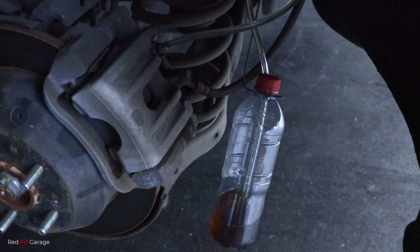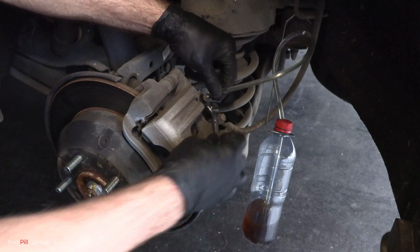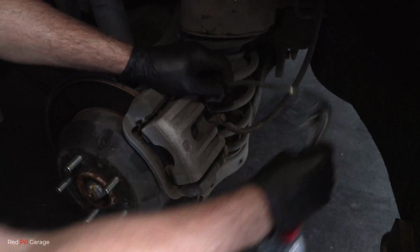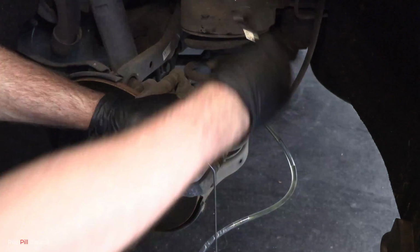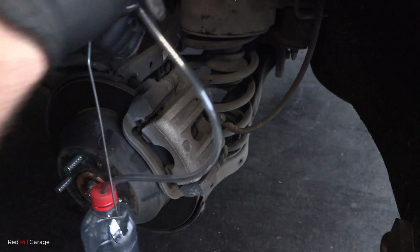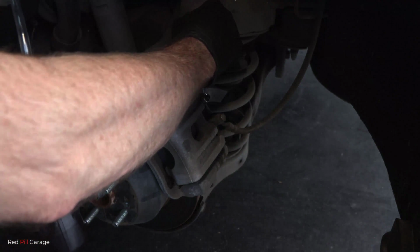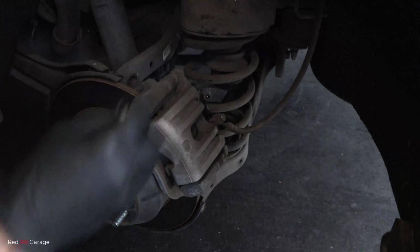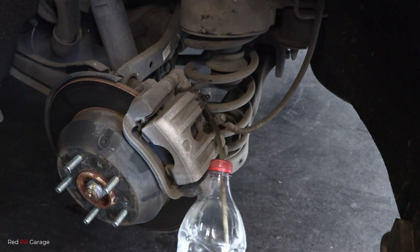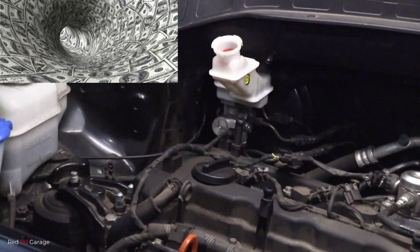Now keep this in mind, this is really important. When flushing brakes, only pump the brake pedal 2 to 4 times, no more than halfway travel. The reason for this is because if you do it too many times, you'll run out of brake fluid in the reservoir bottle and you'll have to bleed the whole system again. And if your car's fitted with ABS, you'll be in a lot of trouble because more than likely you'll have to get the car towed to a mechanic. Your mechanic's going to have to reflush the brake fluid using a scan tool, and it won't be cheap.